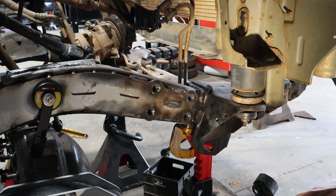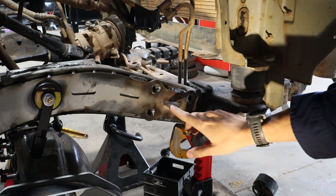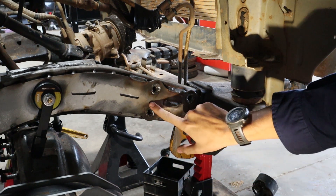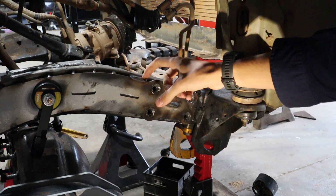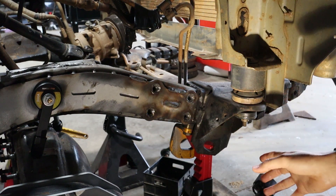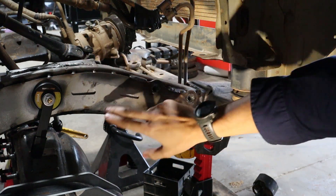We've come through with the die grinder and cleaned up each of these holes, which means we can put the steering box up and bolt it in. But first I'm going to clean up this weld here — we want it nice and flat so that steering box can mount nice and flush. I'm also going to grind back any proud welds and come through and weld up just behind the steering box so that it's all welded. I can put the steering box on and basically leave it until we need to paint.